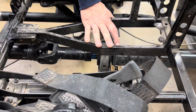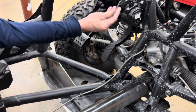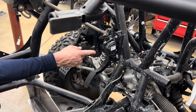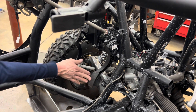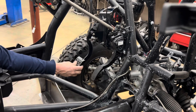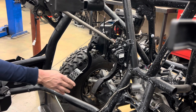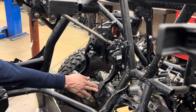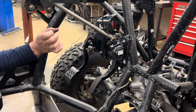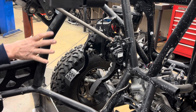Up in here we've already got our Tesla accelerator pedal, but this is actually a Ford product — it's got a Ford part number with full FoMoCo on it, so Tesla is using Ford parts. We've got our little bracket up here. The brake switch isn't in yet, but the Tesla accelerator pedal signal and the brake light switch are the only two inputs needed to run that motor in the ZeroEV controller.